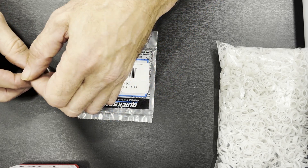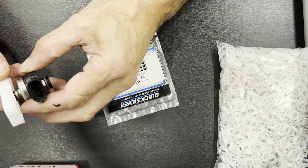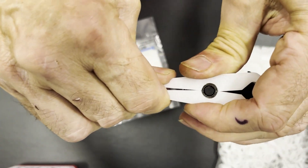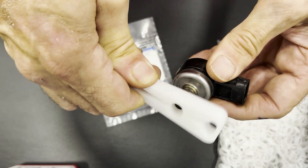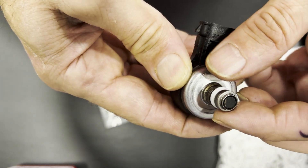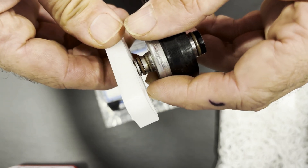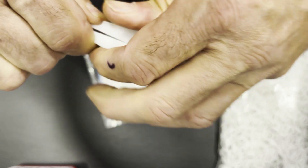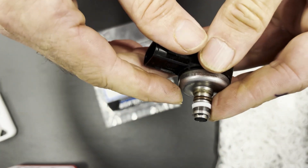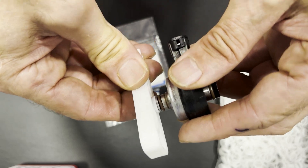Got your injector, got your seal. You put this on — the seal's on. Get this compression tool and you compress the seal down, get it over the lip, squeeze it. The seal is now compressed. But something happens with this tool: first of all it's still very loose, you can see with your eyeball. And if you attempt to keep compressing it, you'll actually get this little pocket, this little lip that develops right there. That means when you try to insert it into the block, it's going to get caught.